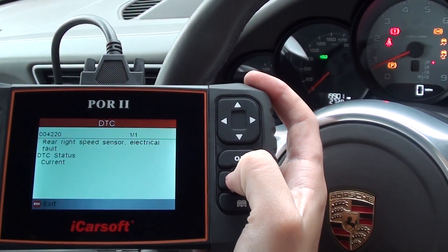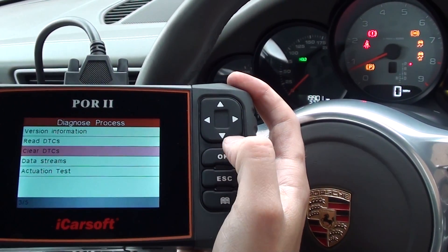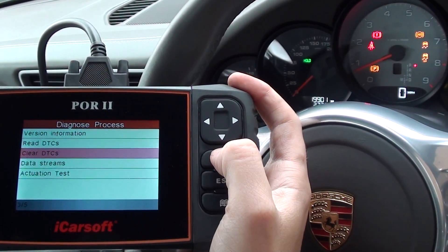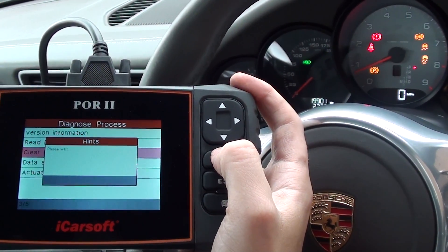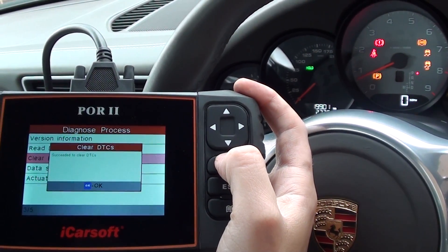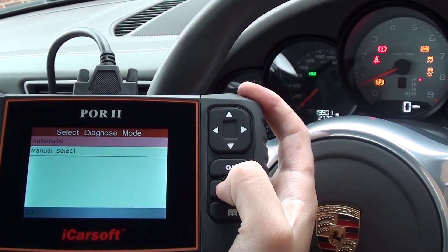As you saw, the warning lights are still on the dashboard, but what we can do is just clear them and we should see an end to all of the warning lights regarding this fault. We'll click OK — it says 'succeeded' to clear DTCs. The lights are still on momentarily but as we slowly come out of the system...